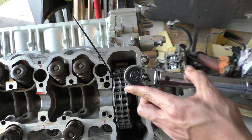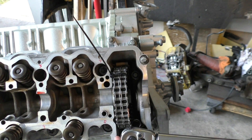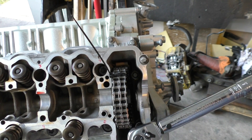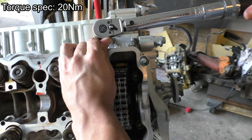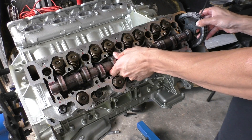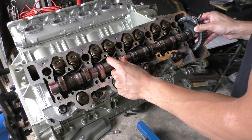After the 10 main head bolts are torqued down, there are four other bolts that link the head to the timing case — and one goes to the block. These four smaller bolts need to be torqued down to 20 newton meters. Next it was time to install the camshaft, so I put some assembly lube on it and placed it in.